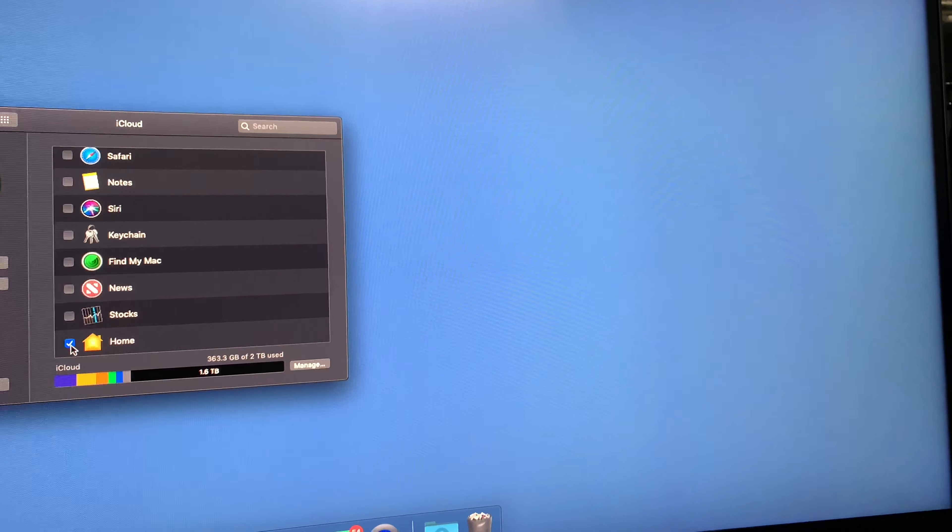The first thing you're going to want to do is go down to the bottom and select Disk Utility, because we want to erase the disk first — make sure everything is off of it and it's clean. Once you get into Disk Utility, it should be the one called Macintosh HD, not the OS X base system. Go up to Erase, keep the format as APFS, and erase. Now our disk is totally erased — lots of free space. Now quit the Disk Utility.